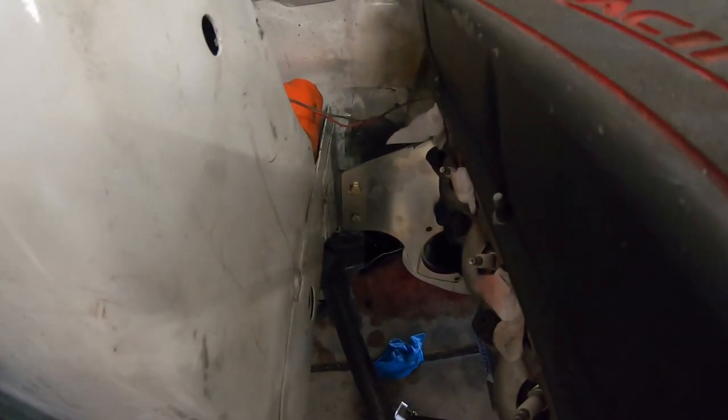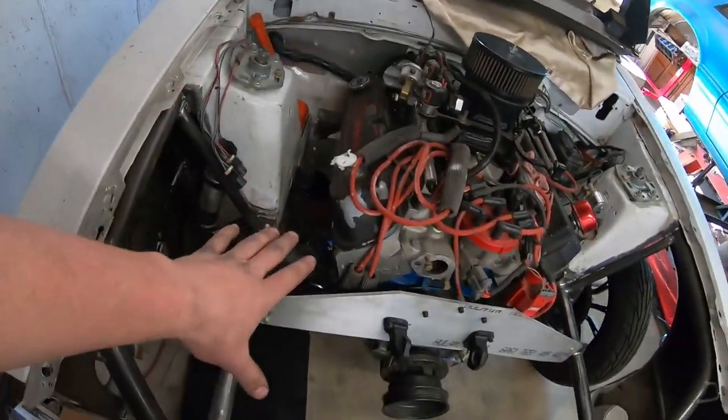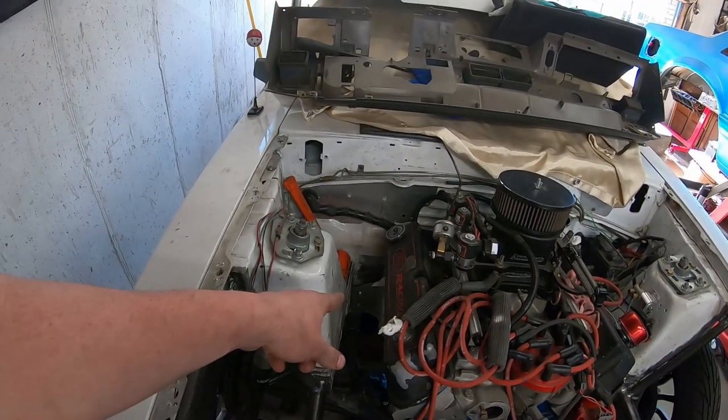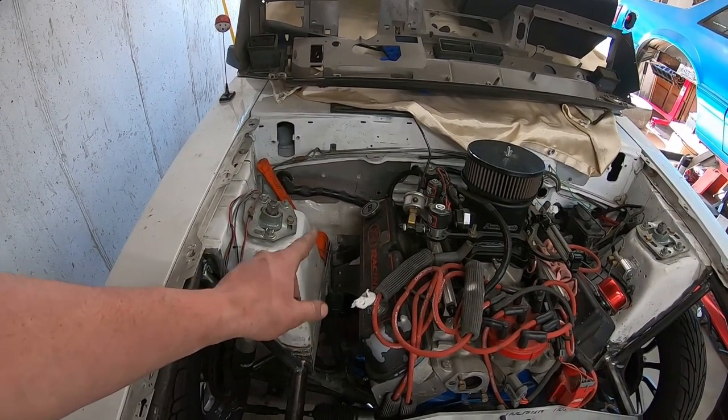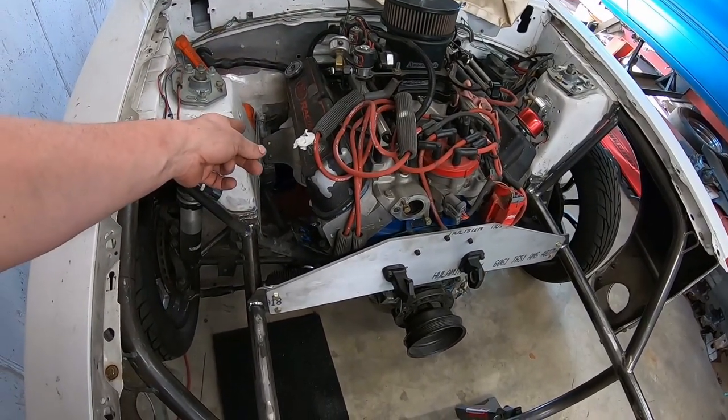Alright guys, I had to swap these real quick. The more I thought about it — and if you're new to this stuff, using mid and motor plates, front plates and stuff like that — make sure that back tab goes on the back of the mid plate. Because if you pull the whole engine and tranny together, that tab's gotta be out of the way. Felt like an idiot, had to fix that real quick. I am going to get ready to clean all this up and if I get to welding later today I'll start filming it.